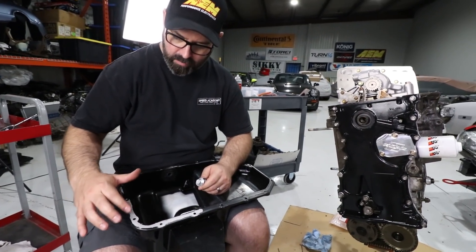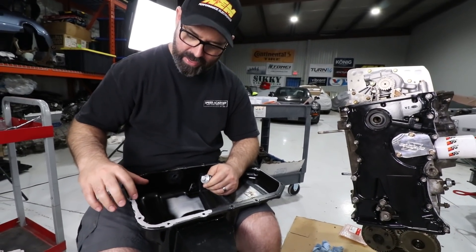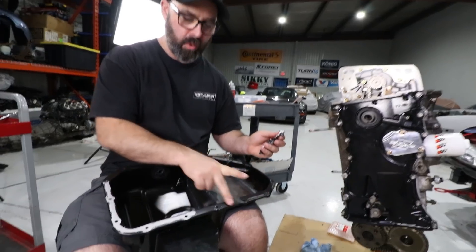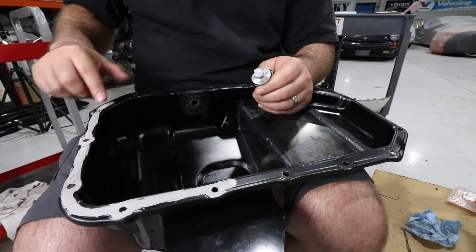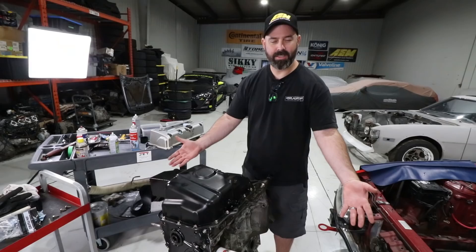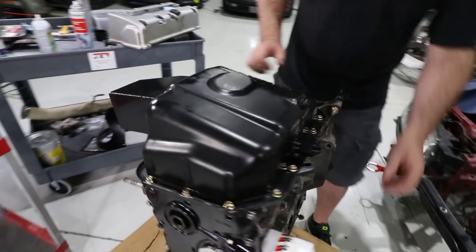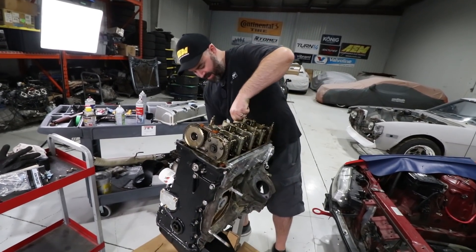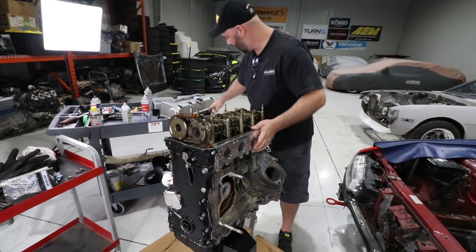It's time for more Honda Bond. Peter is still banned from RTV-ing oil pans — he's on the no-fly list for that. These oil pans are nice — they've got kind of a raised section around the bolt hole, so it guides your application of the Honda Bond. Once that's on, we'll flip the motor over and throw the valve cover on. Sealed to perfection — there will be no leaks here. I'll turn this guy over carefully and line up the hole.